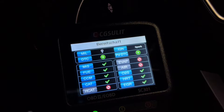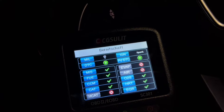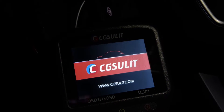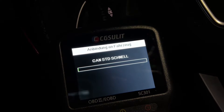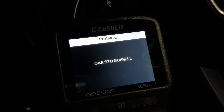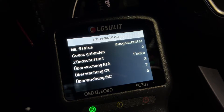In the basic option, you cannot code with that device and you cannot erase your maintenance lamp, but you can use it to scan the DTCs and find DTCs if there are any available. Then you can fix the problem and after that you can delete the DTCs — this is the most important thing.